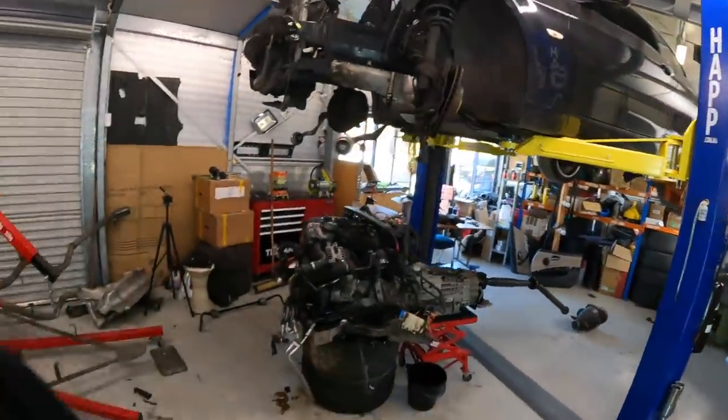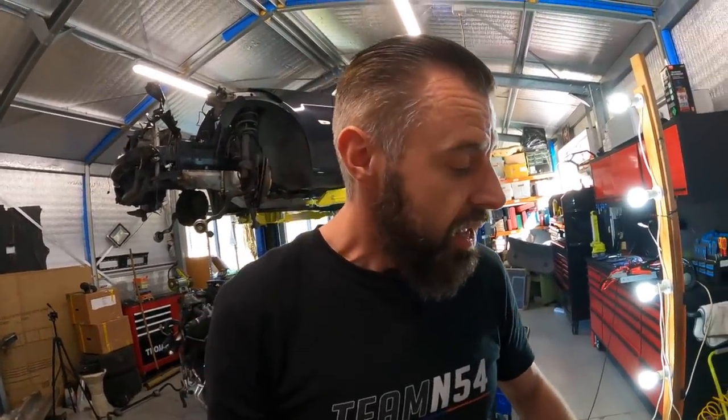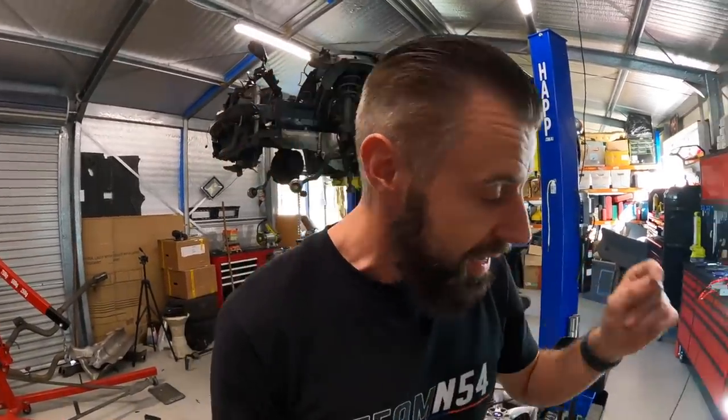The other thing you'll need is a DSC pump. The DSC pump compatible with the DCTs was fitted from September 2008 onwards, so you'll only need to change it if your car was manufactured before September 2008. Mine falls into that, so we will be changing the DSC pump. Connected to the DSC pump is the DSC sensor under the driver's seat — it's essentially a G-sensor for yaw pickup. That sensor also needs to be from September 2008 onwards if you're going for the DCT.